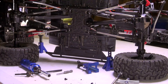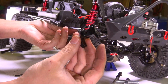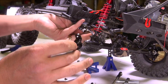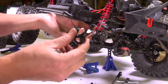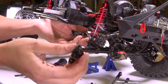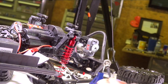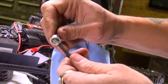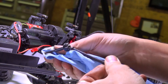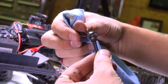This is a three-link setup right here. I want you to keep in mind this top link. What was happening when I was putting on these aluminum pieces is it's almost like it was clocked wrong when they made it. It was almost like it was too far back. When your steering is clocked wrong, you actually steer on an angle instead of nice straight and forward — it's really hard to explain. Just using a little bit of lightning lube bearing grease, gonna make sure to work it in nice into the CVD joint, then wipe off the extra. Yes, it will still get some dirt and grime in there, but it's nicely protected and I feel confident against the water — I don't want anything seizing up in there when it's going through the mud or the water.